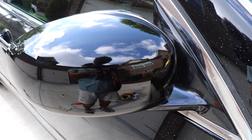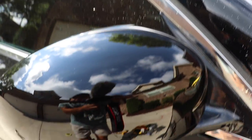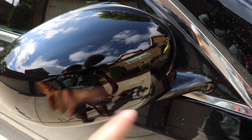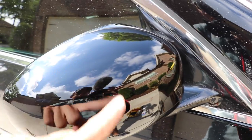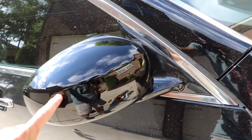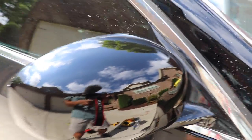Here is the finished look. I polished with Meguiar's 105 and finished with Meguiar's 205 — and check that out. I was not expecting it to look that good. In person I actually cannot even see where the contrast is between where the clear bra was and where it wasn't. There's zero contrast whatsoever — it's completely blended together and brought back to new condition. So everyone, it really is that simple to remove the clear plastic bra. The tools I used: the Wagner heat gun, Griot's Garage six-inch random orbital, and Meguiar's 105 and 205.